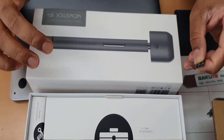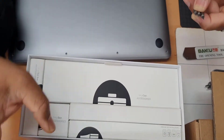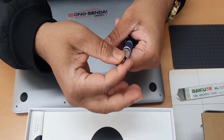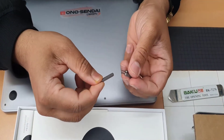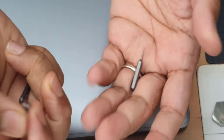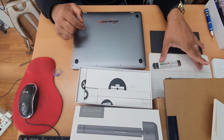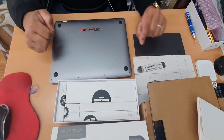In this repair I'm not going to use the automatic screwdriver pen because those screws are very sensitive. I'm going to use the same screw bits in my existing handheld screwdriver. The good point with this screwdriver is it comes with all the markings — T5, T3, and Pentalobe P2. These three we definitely need inside to replace the screen. Also use a paper or magnetic board to organize the screws, because all screws are different.